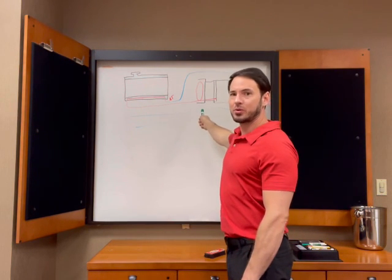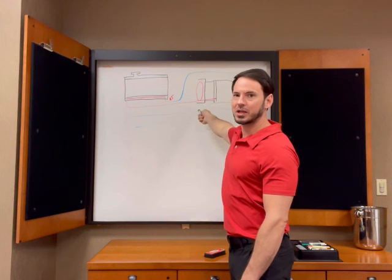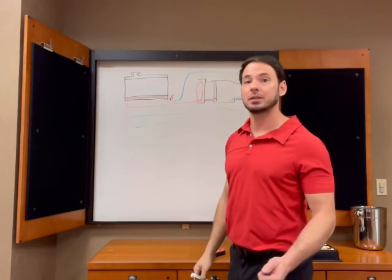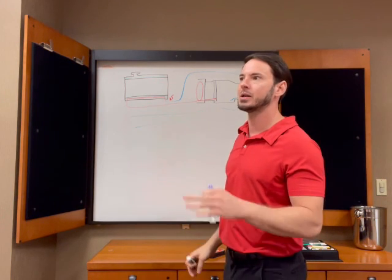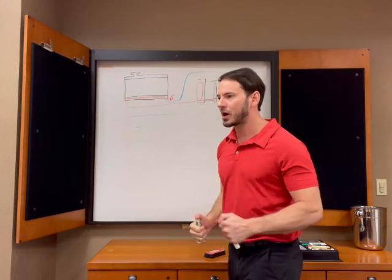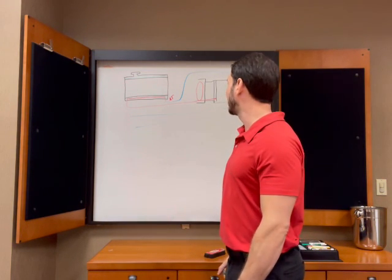And I'm going to try to pull this car up the mountains, right? Well, the transmission is going to have to be in a low gear because the engine is not generating any power. Not only that, remember what I said about the torque multiplication, this torque converter is going to be unlocked, which of course these transmissions, unless they're overheating, will not lock in any gear except for fourth. So it's unlocked, and I've got my little 90 horsepower engine just chugging away as much as it can, trying to get me up this hill to Breckenridge or wherever I'm going.